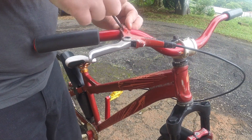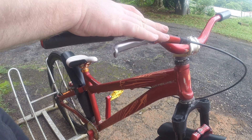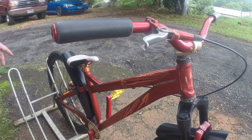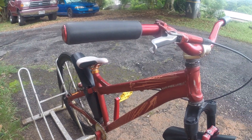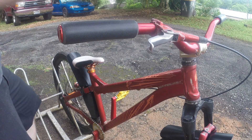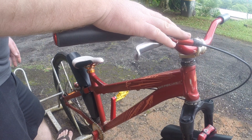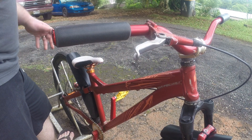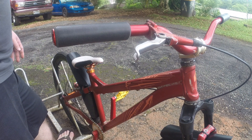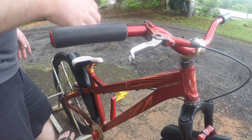Alright, next thing: you got your lever up front, your caliper is gonna be on the back of the bike, right down there. If you have your bike up on a work stand, you want to make sure that your lever is above your caliper — this is going to be the highest point of your system. You want to push all the air bubbles out from there. For me, the caliper is below the lever obviously, so it's fine. If you're on a stand, tip the bike so the lever is higher — the higher it is, the better.